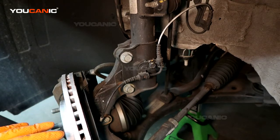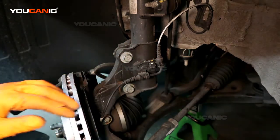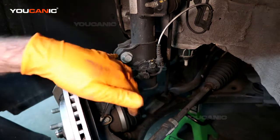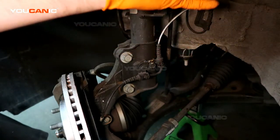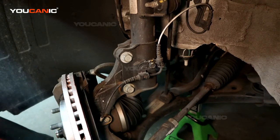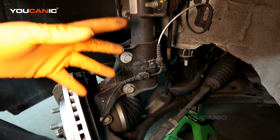So first you would jack up the car, remove the tire. I turned it to the right to give me access here. And then also support your car with jack stands, and then be able to remove size 10 here, size 12, size 10, work your way up, a handful of push pins in the fender well, and 2 screws, and then that way you can get access to the back to unhook it, and then put it all back together by putting all the push pins back in and putting all the bolts back in.